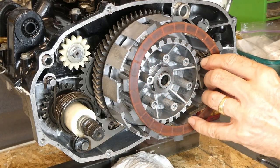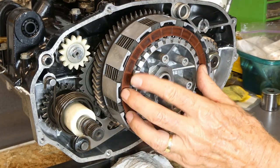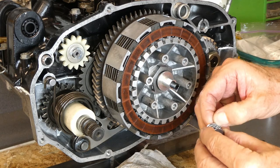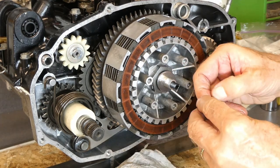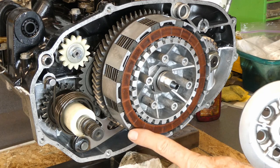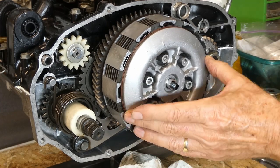I chose the red clutch. Finish with a fiber plate. Here's the new pancake bearing - goes in like so. Flat washer, the bearing, and another flat washer, and the pressure plate. I will line up the arrow with this arrow like so.